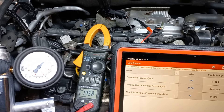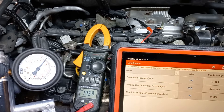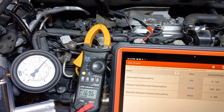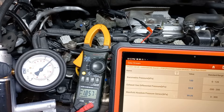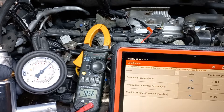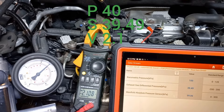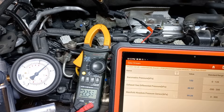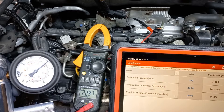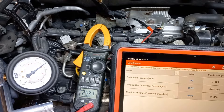I am also monitoring a voltage meter during diagnosis. According to the workshop manual, the voltage should increase gradually when the accelerator pedal is incrementally depressed while the engine is running. You do not need to run the engine at this stage of diagnosis — you can use a pressure pump instead. No exact voltage data is given in the workshop manual, but now you have it. If the voltage does not increase, replace the sensor.